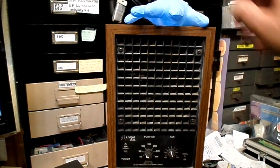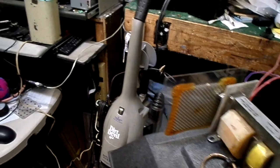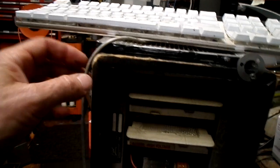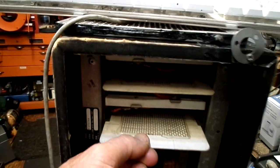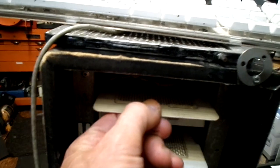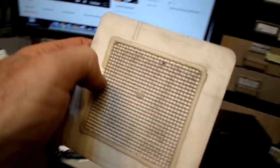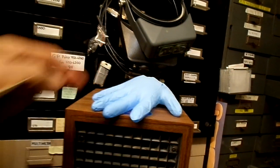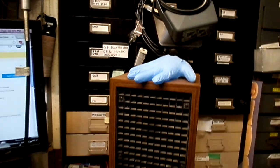Now the interesting thing about ozone is it tends to eat up rubber. I had a situation where a lady brought in a VCR for repair and I changed all the belts on it, and she came back a year later with the same problem. I realized she was a retailer for ozone generators and had one running in the house all the time — it ate right into the rubber. I was so curious that I did a little experiment: I took a latex glove like this, put it in a little chamber with an ozone machine, and about half an hour later the rubber decayed to the point where it would crack when you touched it. So ozone definitely eats into rubber.